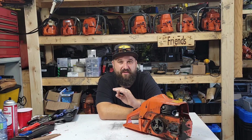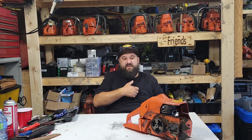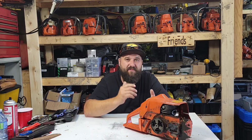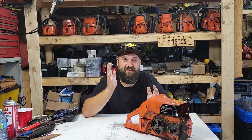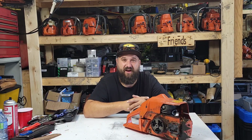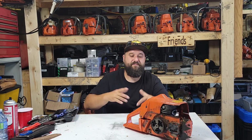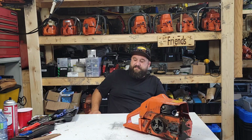Okay. When we went to run the saw, it was having fueling issues. Like it was kind of lean, stumbly. So what did I do, friends? I went to what I know. What I know is the carb kits I use generally, pretty much all the time, run perfectly with a single diaphragm. So I put a single diaphragm back in the carb and the saw ran perfect after that. So goes to show you, friends, sometimes the less you know, the more you know.